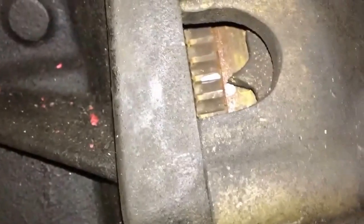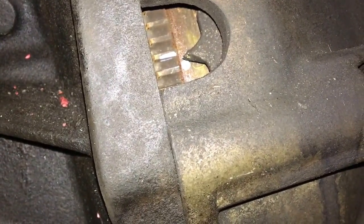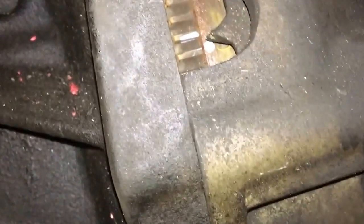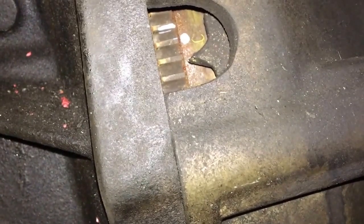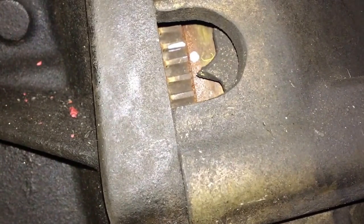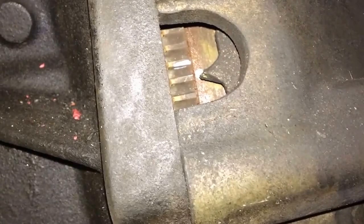The next thing you want to do is turn the engine to top dead center. You can see the notch on the right, the two ridges on the left, and a white paint mark I put on the right side. When you look at the flywheel, there's a zero that almost looks like a C turned on its back — that's actually top dead center. I actually had it wrong, so I'm glad I made this video.